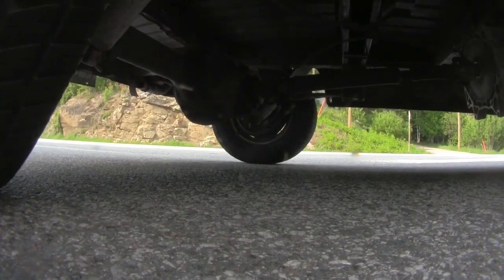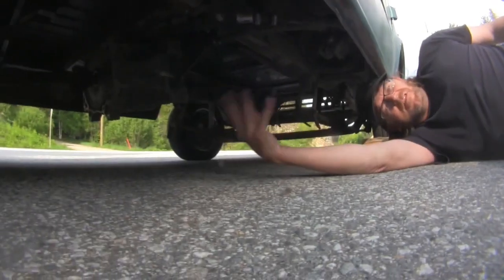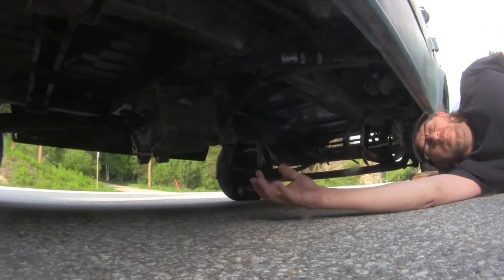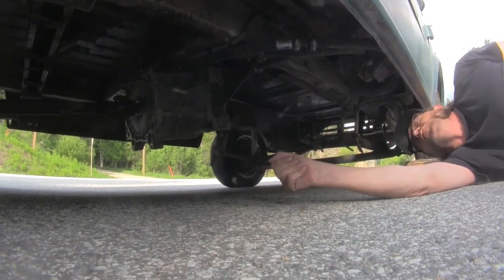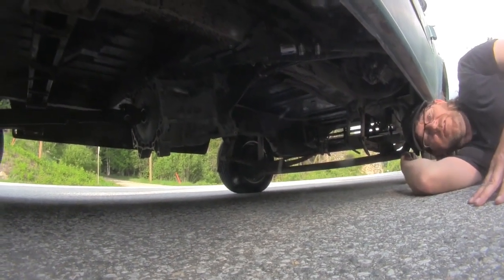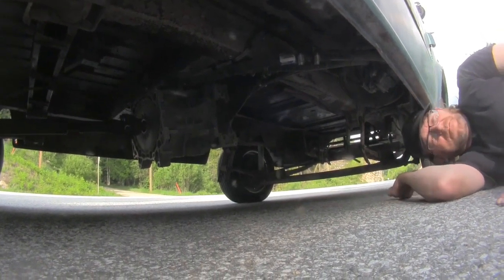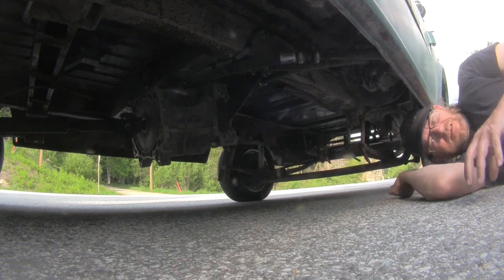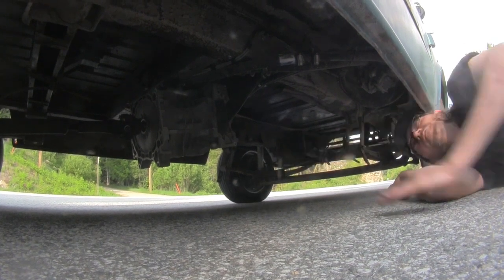That would give me a slightly higher highway speed than a Nissan Leaf and a little less torque out of the hole, but very close. 7.4 compared to 8 to 1 is very close. Because I matched the gear ratio as closely as I could, I didn't really need to run a transmission. The Nissan Leaf doesn't have gear selectors, it just has a single speed transmission. Basically I did the same, only with a rear end.